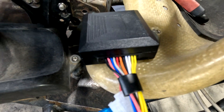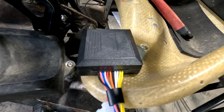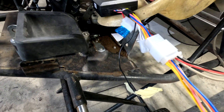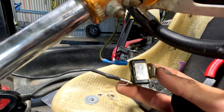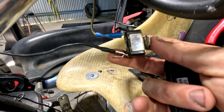You have to go through all the wires because they all do different things — indicators for cars, kill, ignition, starter, and obviously your red and black power wires. There's meant to be an antenna; I think that little black one is it, though on other modules they're much bigger. There's also a little fuse. The pink wire is your kill wire, and so is the gray — if you had just one of them connected to a kill switch, it goes to your ignition.